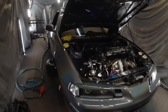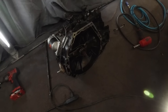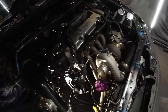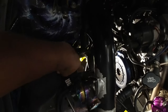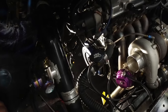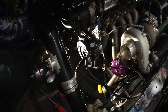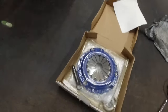I got all those bolts out and your boy got the transmission off. To be honest, this is the first time I've done a clutch with the motor in the car — I've usually changed the clutch while pulling the motor out. One key thing: removing the motor mount gives you the wiggle room you need to get the transmission off. I used a regular floor jack to ease it down into place.